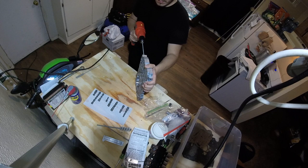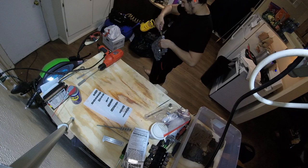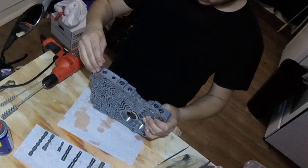This isn't part of the kit. I had to use this tool called a bench buddy. It's basically some fine sandpaper on a brush that you put in a drill. You'd polish all the bores with these, blow out the debris, and use a little WD-40 as lube to check the valves. If the valve falls in under its own weight, it's polished enough. If not, polish more. This one got stuck, but this one here is what they should all look like.